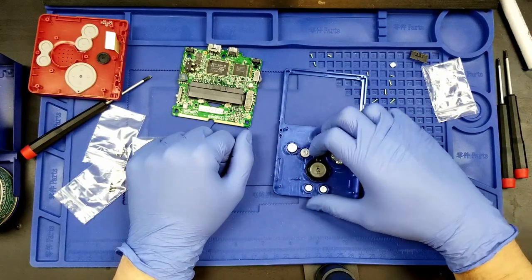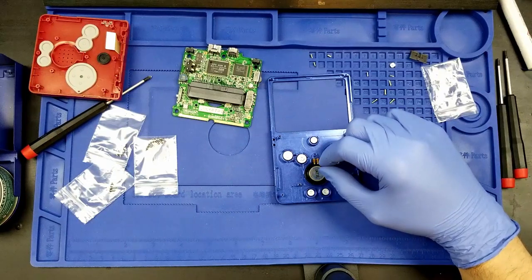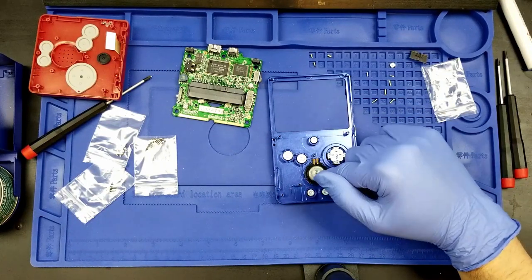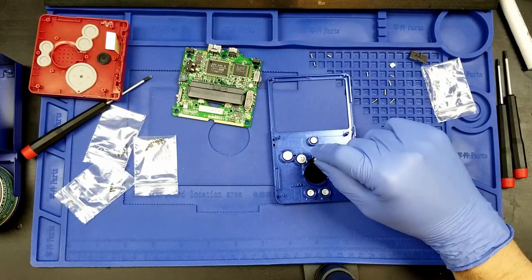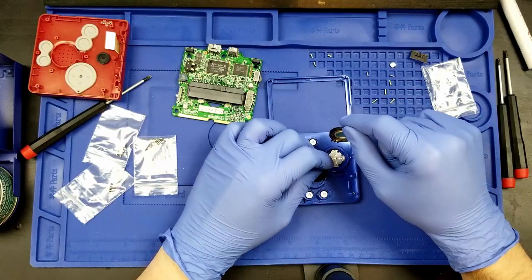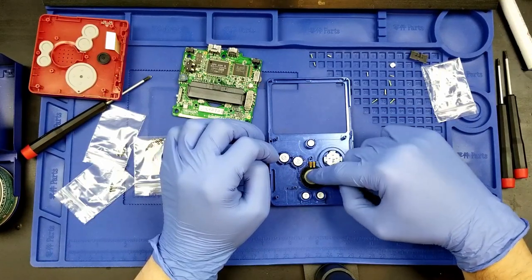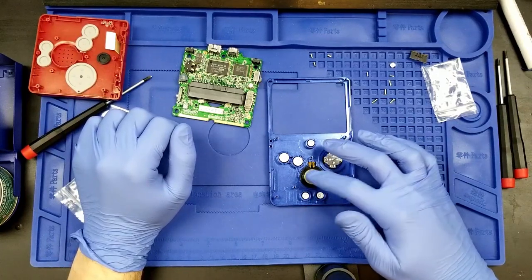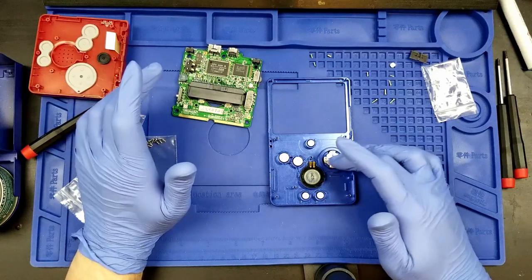I may need further modifications to this if I were to, say, want to install a like 1.5 watt speaker that's for the Game Boy Advance that has wires coming out of it to install it to an amp. This might need a little bit of adjustment. I'm not particularly sure. It might fit down in there. We've got a little bit of an offset, but we shall see about that as we go along. And the actual placement of the speaker could be lower down in that sort of a setup, because it is going to be wired directly into the amp chip, which is wired into the board. All right, so we have those.